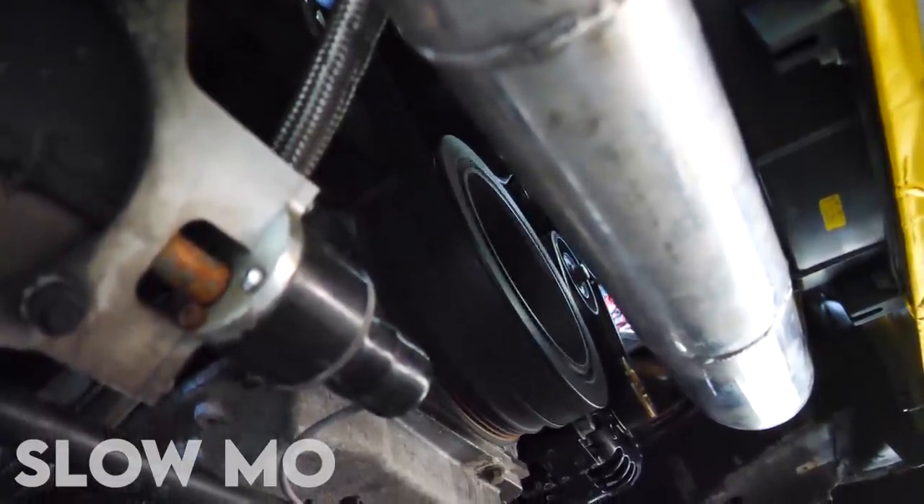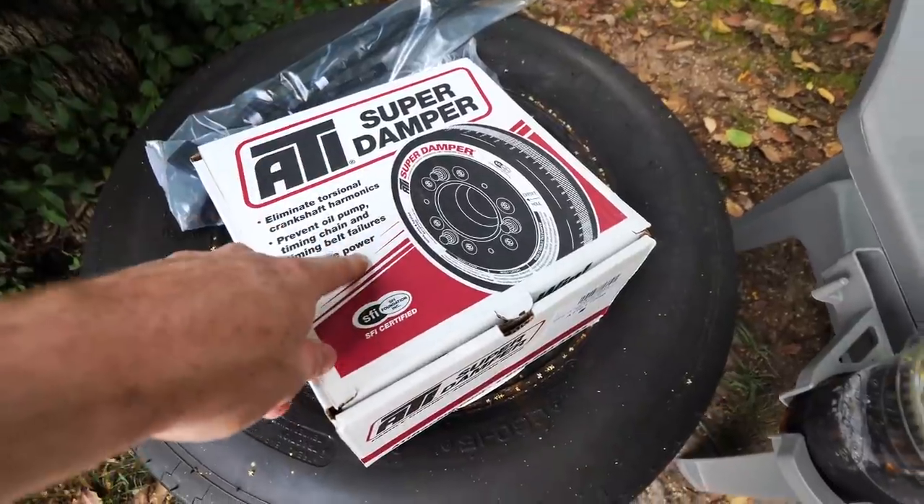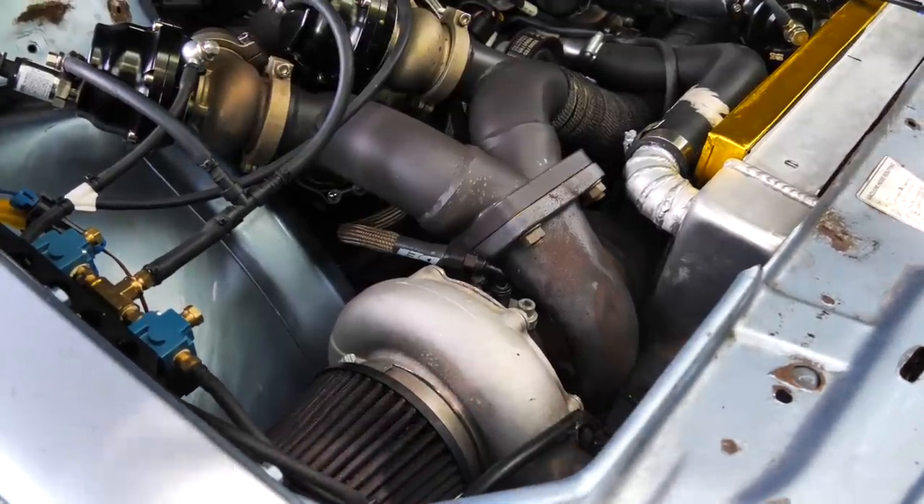The big thing is this, which is a new crank pulley, because something happened to the old one. The Volvo has something called death wobble — not to be confused with the death wobble my drift truck has at 60 miles an hour. This is death wobble in the crankshaft. You can see it most clearly when the car is idling — the crankshaft pulley is actually wobbling all over the place. When I first saw that I got freaked out, but it turns out a wobbly crank pulley is somewhat common on these motors. It's bad because it causes unwanted vibrations throughout the motor, increasing the likelihood of something breaking. So this bad boy will fix the wobble and help combat extra vibrations caused by the motor making twice the factory horsepower.